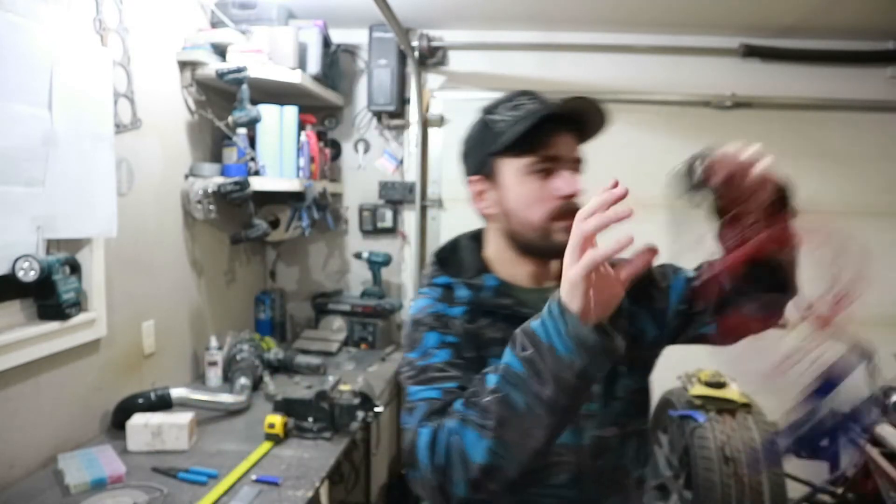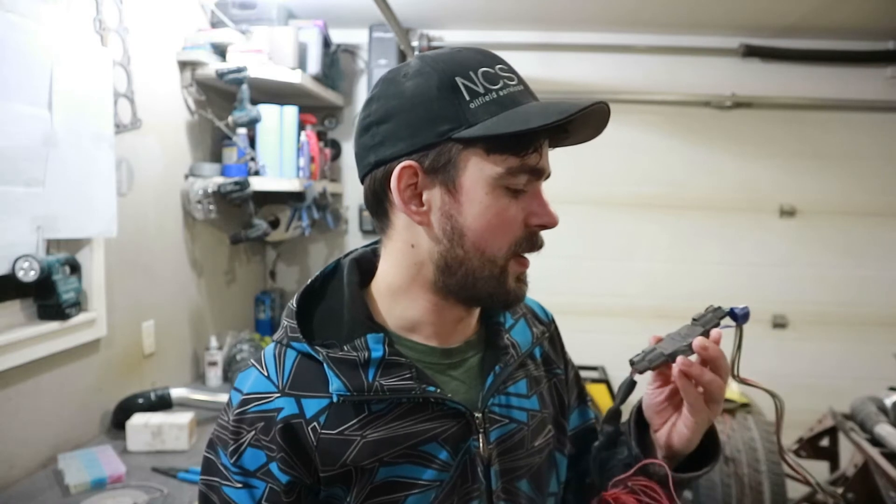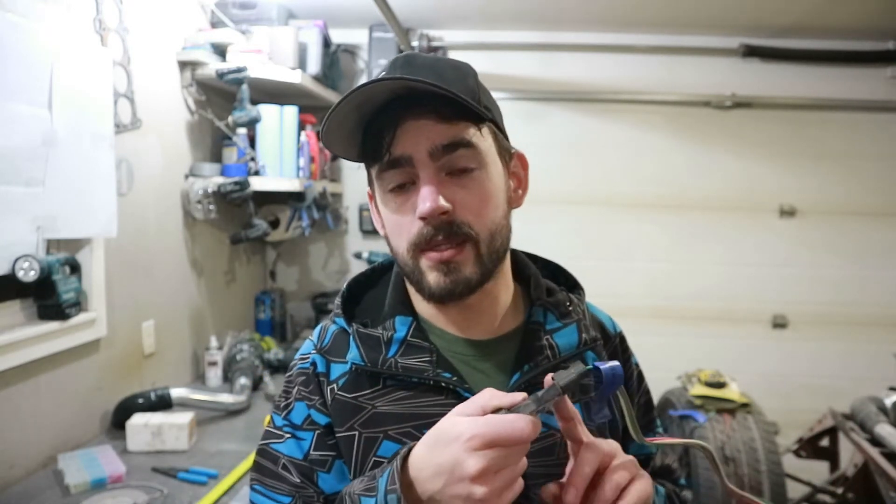The next step is we're going to move on to the igniter chip wiring. It's our igniter chip - it runs our coils. The SR20 does have a coil-on-plug system but it's kind of an older version of it, so we have to have this funky igniter chip. There are five wires that go in and only four wires that come out, so it's got to be doing something - I think there are some capacitors in there. We are eventually going to get rid of this. I've got my eyes on the 350Z coils - they're basically a direct plug-and-play on the SR20; I just have to flip one of the wires on the plug that goes into each coil and then we can get rid of this igniter chip. But I don't have the budget right now, so we're going to find somewhere semi-convenient to mount this for now and shorten up the wires accordingly.